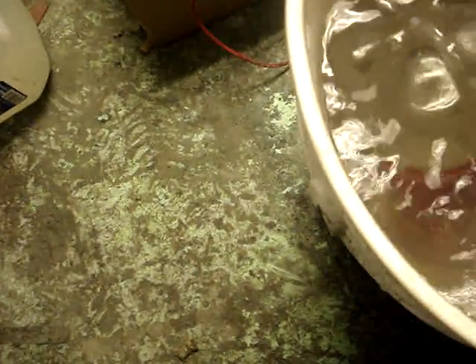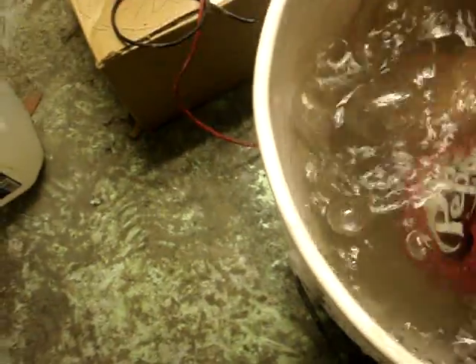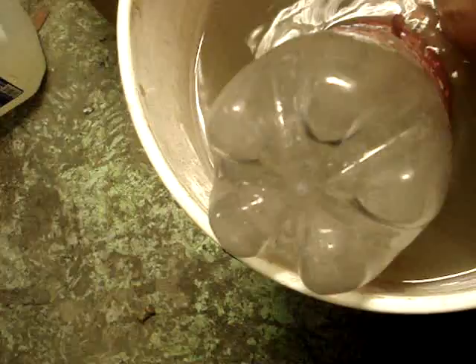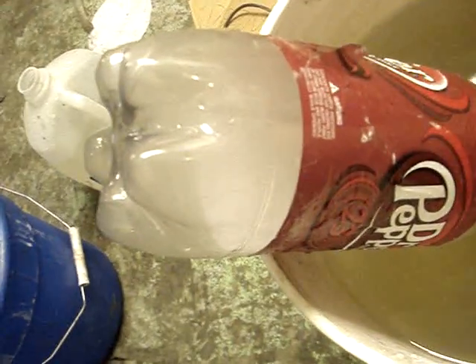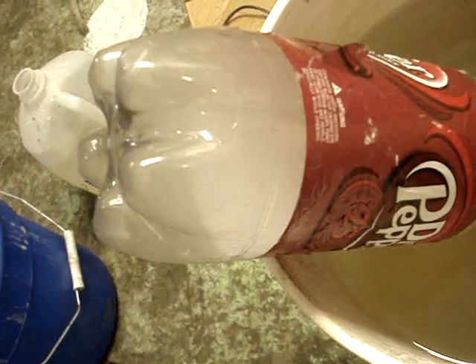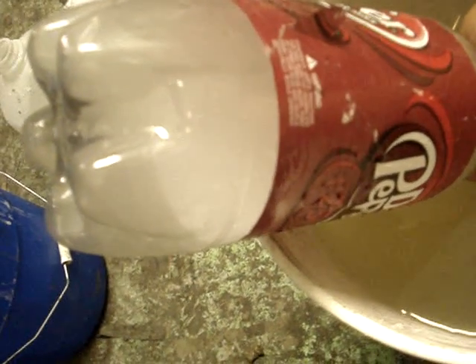This is a two-liter bottle. Remember this is seventy-degree water, so the cell is not warmed up yet. Let's see how clear the bottle is — it's kind of hard to see, but there's almost zero steam or water vapor in here. The other cell that I showed you beside the Suburban has a different gasket material and it steams the living snot out of the water at 65 amps. So this is a lot cleaner, drier HHO. Looks like about thirty seconds.